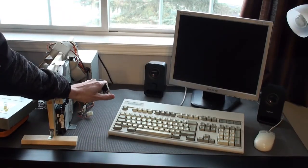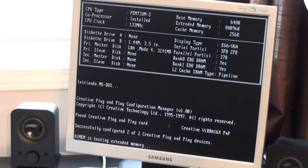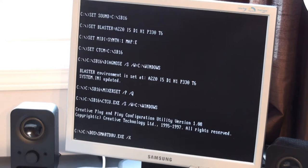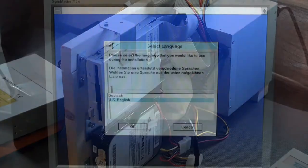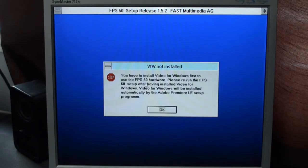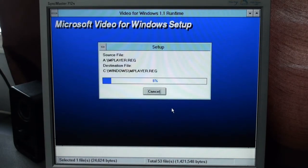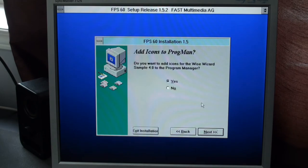Once all is connected, I will turn on the computer and see if everything loads properly. It's initiating properly, which means no hardware issues and that the card bridge is working as expected. Let's go for the drivers. All the software will run under a Windows environment. The first thing I notice is the requirement of having the Video for Windows software installed, which I didn't — so that's what I'll do next. After this, the main installation will run with no issues. All drivers are on one unique disc, which makes the installation quick and simple.